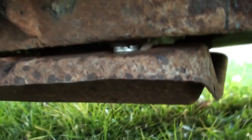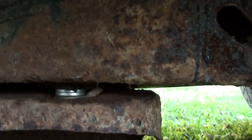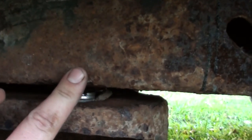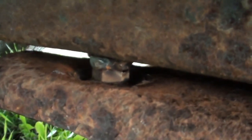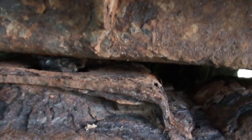Oh, and then here I'll show you this. Where I took it, they had to take this plate off here. The transmission and transfer case and all that stuff mounts to this thing. So they ended up breaking the nuts off that are inside the frame rails. They stripped out or something. So the buddy welded a nut on the two he stripped, and a bunch of washers on this side, and then fired some new bolts in there, so yeah.